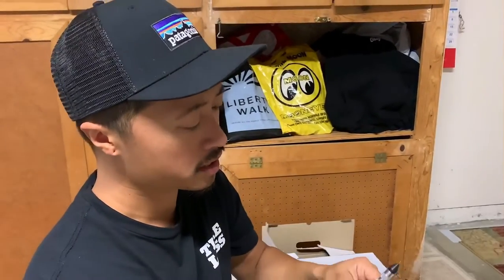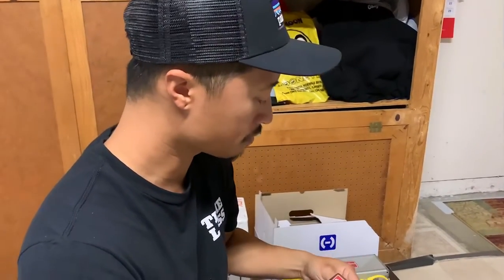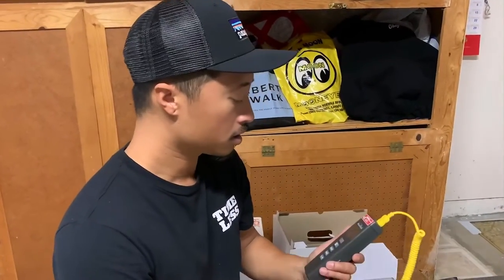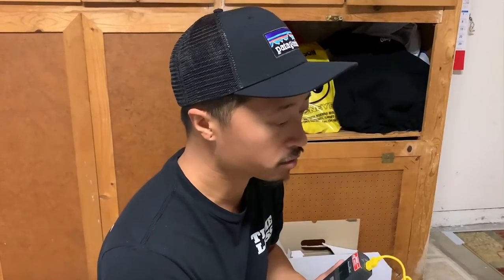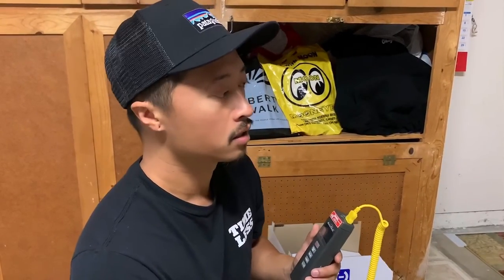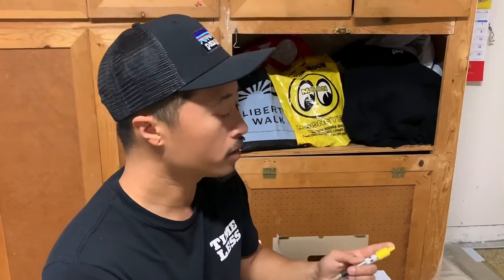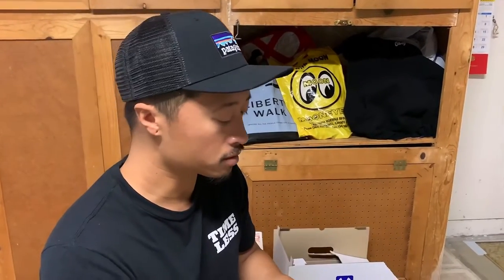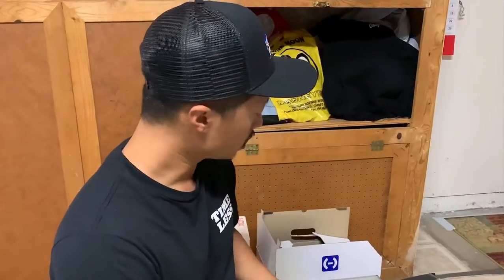And this right here is the Prong style pyrometer. They have other options too as far as pyrometers go, like there's laser ones. Kind of looks like a trigger. But the benefit with going with the Prong style is that you could actually get a more accurate reading under the surface of the tire. Whereas the laser will get infrared of the surface of the tire, this right here you can stick a little bit more into the tread. So I wanted to get something obviously more accurate is better without spending like $300 on something either. So that's why we went with this one.